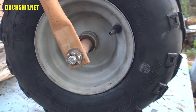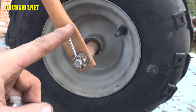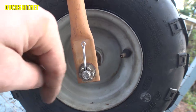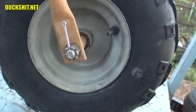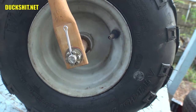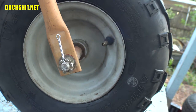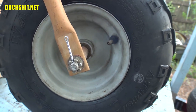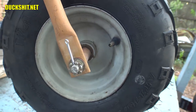After getting a closer look, I'm trying to put the cotter pin in and it goes in most of the way and stops. It's not going in straight — it's leaning off to one side — because the hole is not drilled through the axle straight. In order to fit the proper size pin in, I'd have to either wallow the hole out bigger, straighten the hole out, or just use a really tiny skinny pin and drive it in all crooked. That's some authentic Chinese manufacturing right there — piece of crap. Anyway, I'll get back to that; we're not riding immediately.